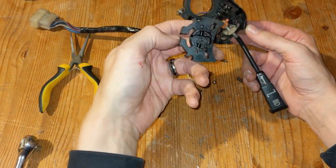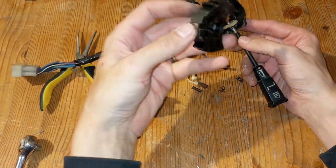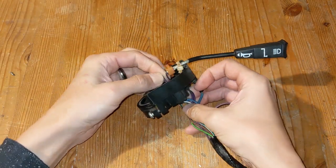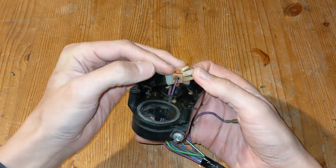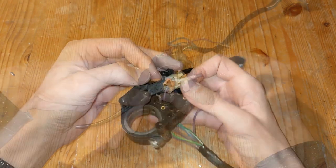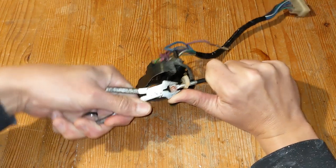But as I suspected, it was pretty grimy inside. I don't know if this was already broken, or it broke as I was pulling it apart, but this wire here was broken off. It goes up the stalk to the horn switch, and apparently is just clamped in by the stalk itself. So, I pulled the stalk out of the mounting.